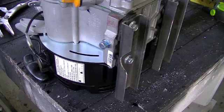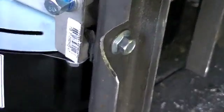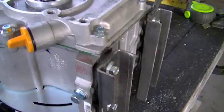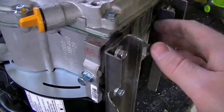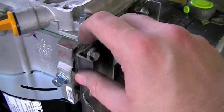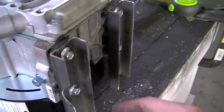A couple of quick things while this engine is still here on the workbench. I did make that little notch in there, as you can see. Another thing I added were these little rubber pads — I got them in all four corners. Hopefully that'll take the place of that mounting bracket. Remember, I mentioned in a previous video that it's important to have some vibration dampening on these engines, otherwise you can crack the aluminum engine housing. So I got these little rubber feet in there. Got the notch cut, so we'll go over to the bike and see if we can get it to fit.